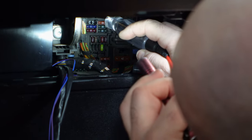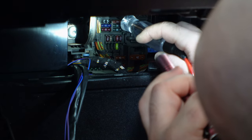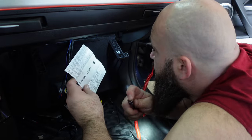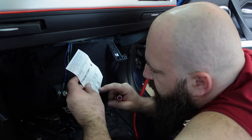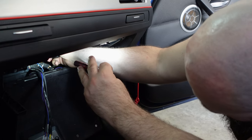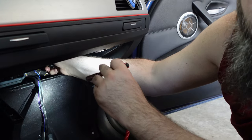While I was pinning for power on the fuses, because there are the little pieces where you can actually test them, I found a few fuses that weren't getting power. One of the fuses was, I believe, fuse 38, and it directly controls the DME. As soon as I pulled this 15 amp fuse, I saw that it was popped pretty good, and I had to replace it with a good one. The fuse ended up fixing the terminal 87 error that I had.